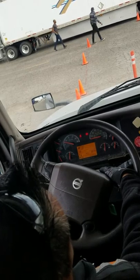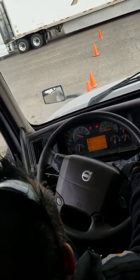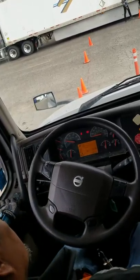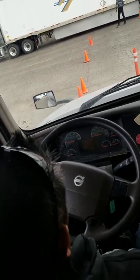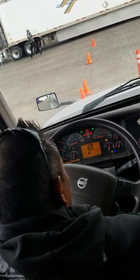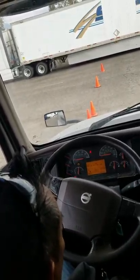Okay? So now the next test I would like to perform is the applied brake leakage test. The purpose of that test is to make sure I do not lose no more than 4 PSI in 60 seconds. So I'm going to go ahead and engage my transmission in low gear. I'm going to power down, release the clutch, power up my gauges to get proper reading, release my parking brake, close my trailer brakes, wait for that needle to settle again.